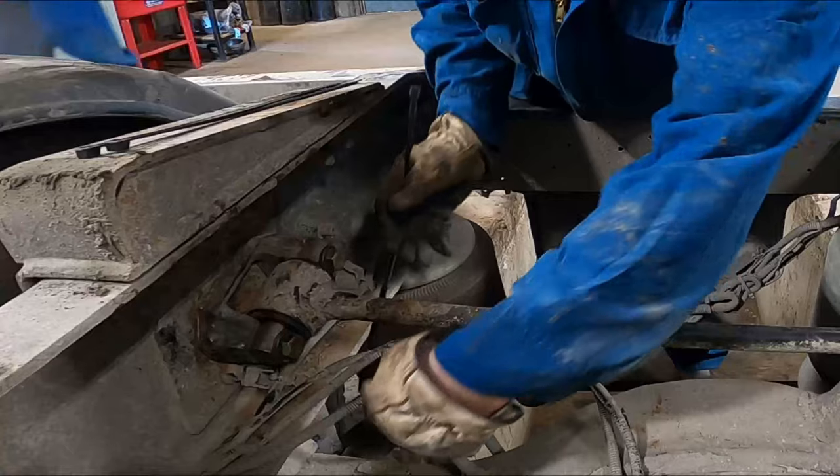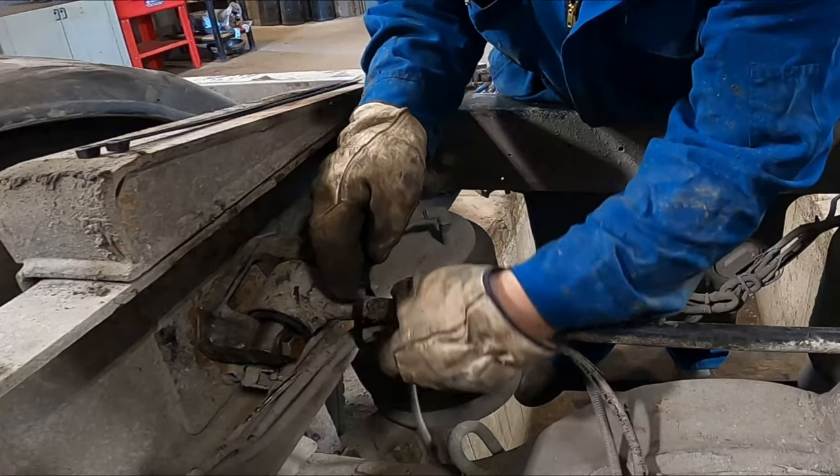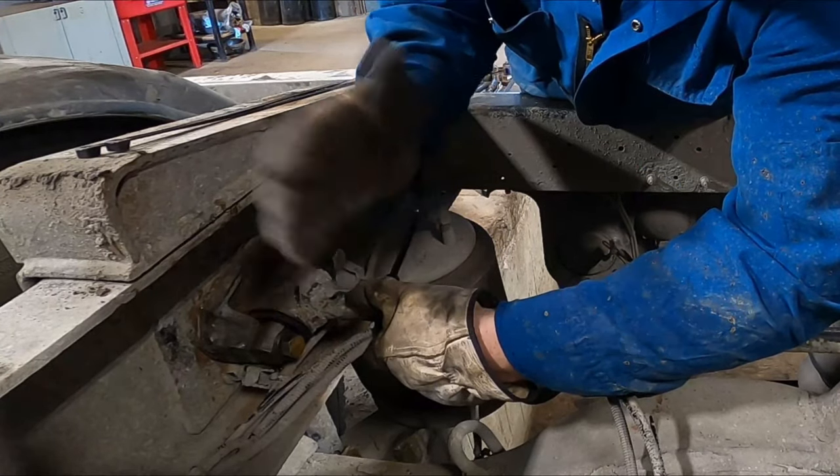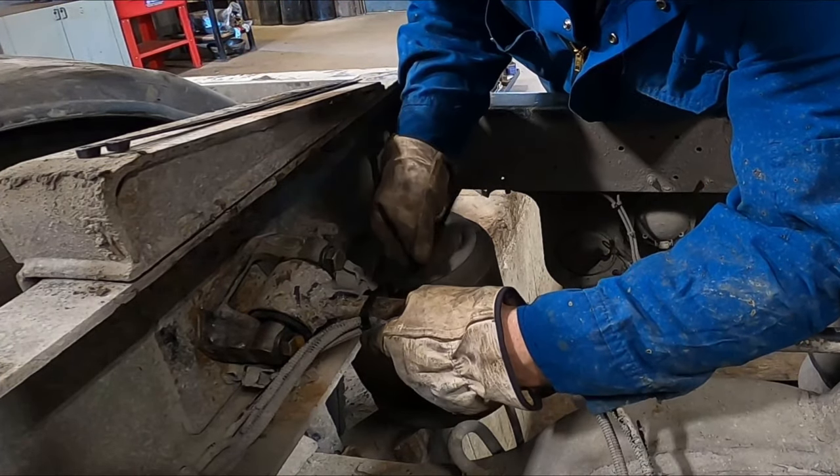To be a professional, you got to put things back exactly how you found them. So we're actually going to zip tie these back up here. You've got to make sure there's a tiny little bit of slack in there because this torque rod goes up and down as the suspension moves, so you want a tiny little bit of slack. You want the hoses to be away from your bolts and your torque rod and other hoses. We'll put one right here so this doesn't unplug on them. Make sure it's all nice and tight.